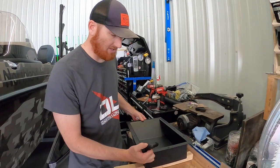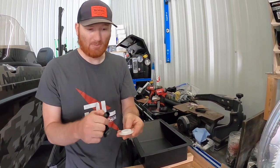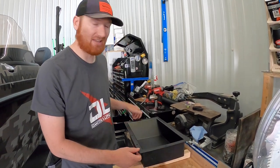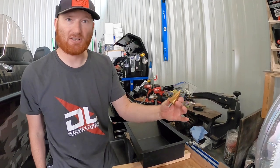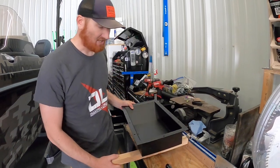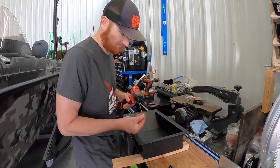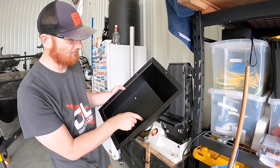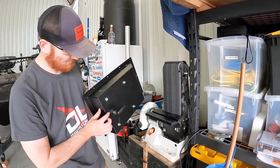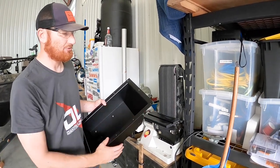We've got a big drain hole in there, but I really wanted to make that as flush as possible so we don't have an eighth of an inch of water sitting there. I did find an actual flush drain — stupid expensive for a piece of plastic — but I've got to get that hole pretty big. Drilling into aluminum is kind of a pain. I've got a step bit, but that's not going to be big enough because this is over an inch. So I'm going to put a piece of scrap wood through the other little holes as a center guide so I can use a regular hole saw without it jumping all over the place. I drilled the bottom holes and tapped them so I can put a machine bolt in and keep the water from going out. We've got our drain flush all hooked up. Now we're just going to nip the corner off because the contour of the boat front deck makes it a lot easier.